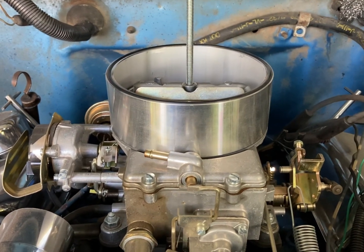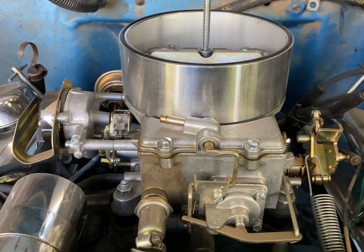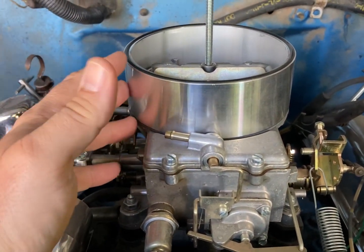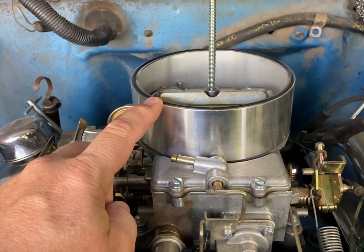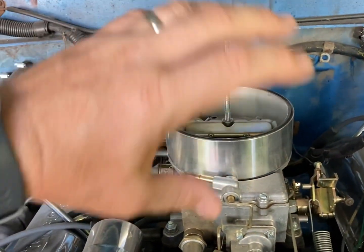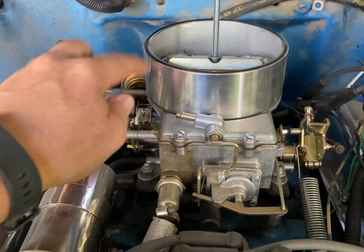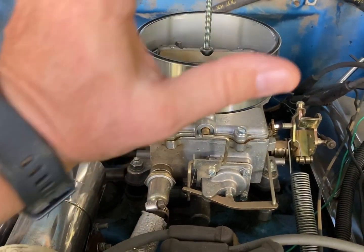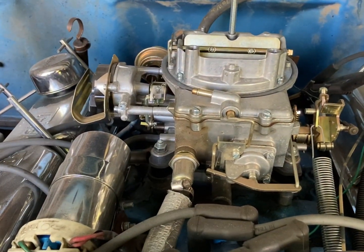An important piece of a blow-through carb, especially a two-barrel, is you want to have a carb spacer — velocity stack. There are some other terms for these, but you want to get one of these because it's going to help with the airflow as it goes down over the carb hat into the actual carburetor itself. It gives a two-inch length expansion for air travel, so definitely pick one of those up.